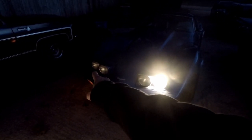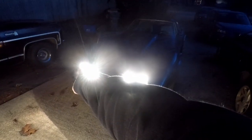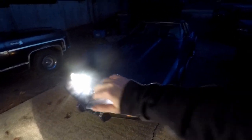We made it back home and I've noticed an issue with my headlights. This is low beams — high beams is bright and great, but the high beams are flickering and going out whenever the car is really vibrating. I think I have a loose ground. My low beams: I only have one working low beam — that one's not working. But if I flip the high beams on, all four work, so that one's not burnt out, it just isn't working on the low beam switch for some reason. I have some wiring to figure out here, and that's something I ideally want to take care of soon.